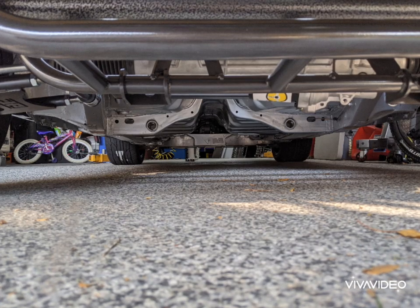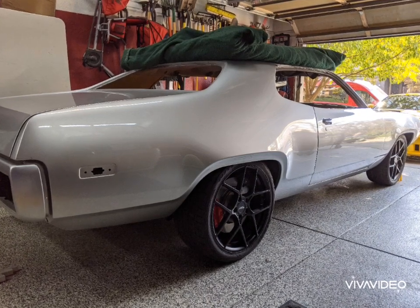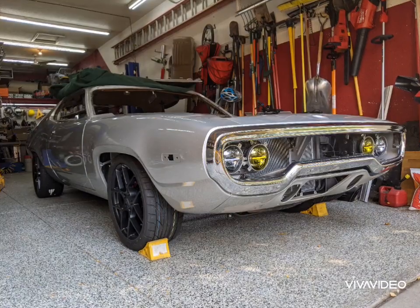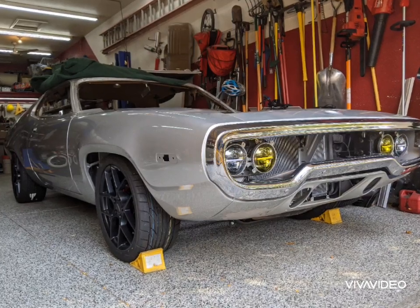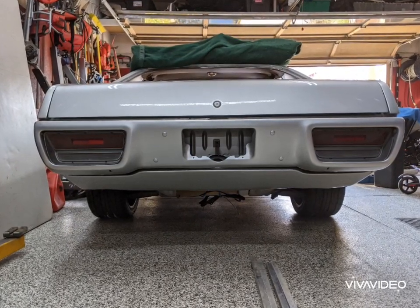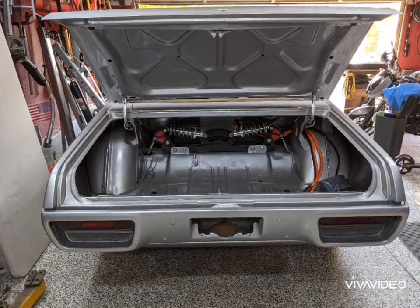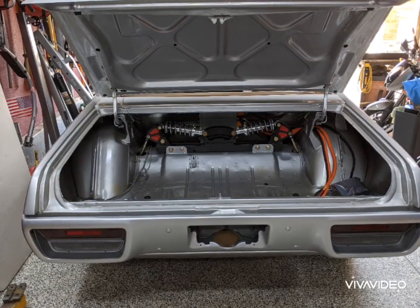Here's a look under the car — it's kind of nice now. I can get a feel for the ride height and the stance, since it's sitting on its own suspension front and rear. There's no weight in the car yet, no batteries, so it'll ride a little bit lower, but I have full adjustability over the ride height. It definitely looks good with the nice fat tires front and rear. Looking at the back underneath, I can still fit some wider tires, but it's a cross between rolling resistance and traction — I'll have to get a feel for what I need. The rear suspension in the trunk is at about normal ride height position; I'll just have to set the preload once I get the full weight in the car.